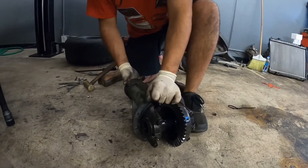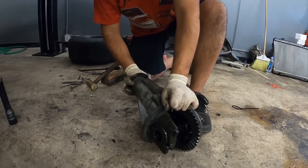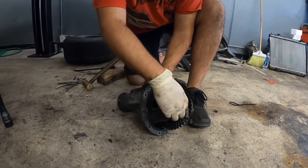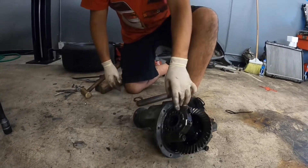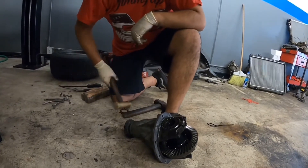There's way too much play — basically doing an attack instead of being like a normal driver. Every time you kick the clutch, it just goes. So that's probably from a clutch kick. Since they didn't set the preload, they just damaged it instead of driving the car forward — essentially like grabbing a hammer and knocking it.